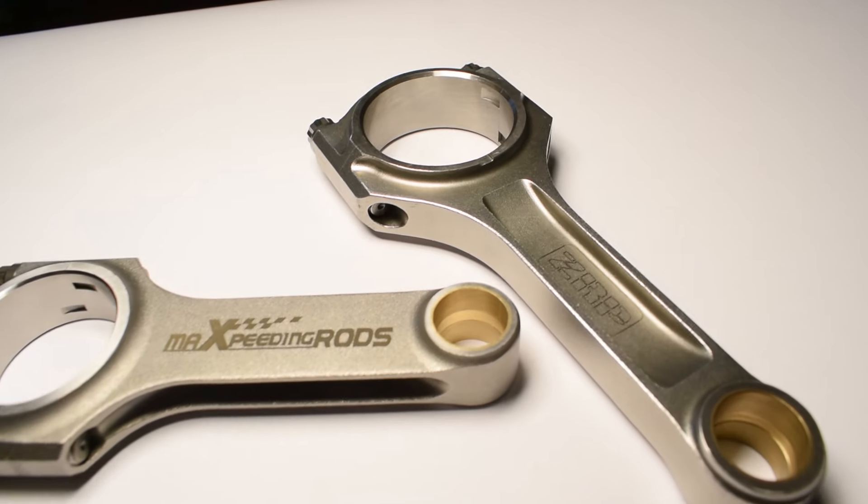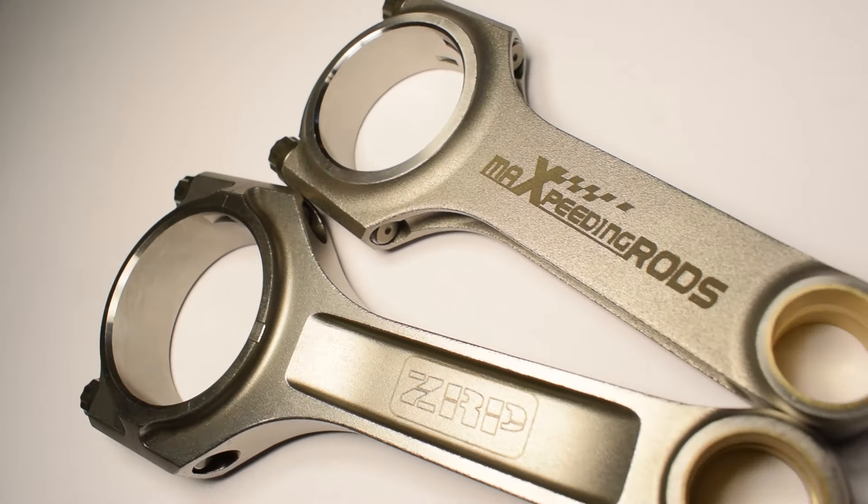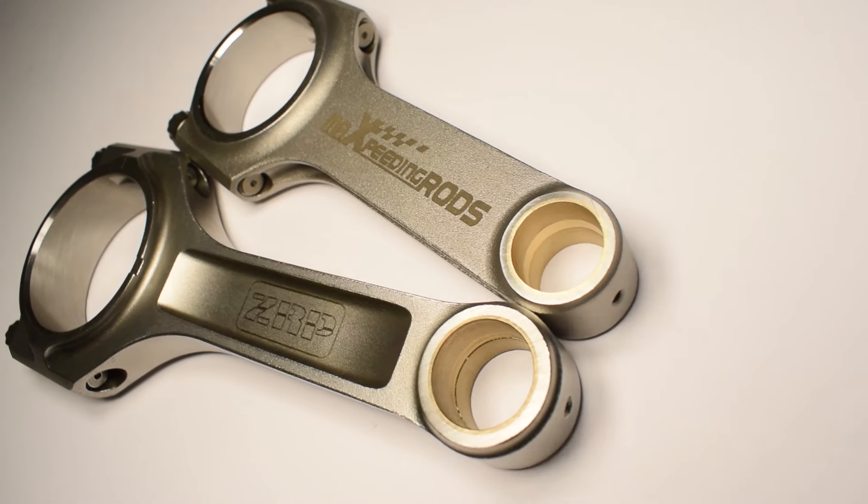There are many schools of thought when it comes to H-beam versus I-beam. One such school of thought says that, all things being equal — although in practice they never are — the H-beam is the stronger design and the I-beam is the lighter design, and that the H-beam is better suited to the high combustion pressures found in forced induction engines while the I-beam is better suited to high RPM operation because it is lighter. This is a rule of thumb at best — honestly it's not even a rule of thumb — because today there are so many exceptions to this rule that this school of thought simply doesn't hold water anymore.